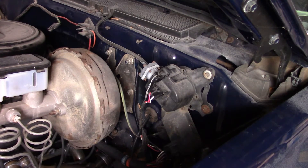So it looks like the delay module was the problem. If you have a problem where your wipers are coming on intermittently and you've got delay, that's probably what it is. I did a little research on YouTube and found one guy's video — he had an older model, pre-84, like 73 to 83, and his wipers were still on the dash. He was having an issue where it would come on every 15 minutes, replaced his delay module and it went away. This one was coming on every 30 to 45 seconds.